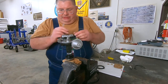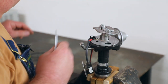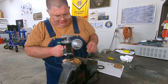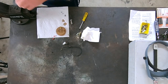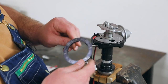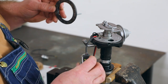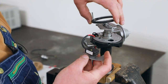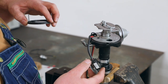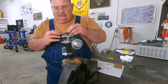What we want to do is just get this hanging here. These screws will have to be mounted finger tight, but we need to mount the magnet ring. There are eight magnets that go into this ring, and the magnetic field from the magnets as they rotate is picked up by this sensor, and that's what will now replace the points and control the spark.